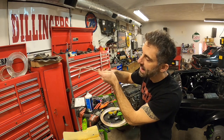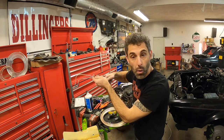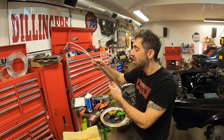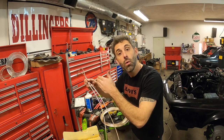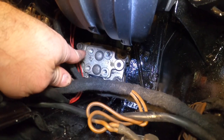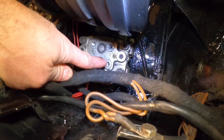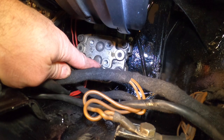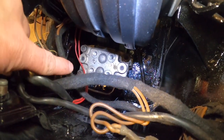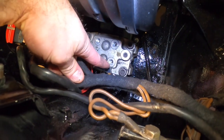As you can see here, I made the 90 degree bends at different heights, and that's to allow for one to go underneath the other in this manner if I absolutely require it. So I want to label one to be the left, one to be the right, and they're both going to go toward the rear of the car. VL and VR are the two for the front, right here, and HL is there. So basically, these two are the ones I need to tap into. The one with the larger 90 degree angle is going to go in the rear, and the one with the smaller 90 degree angle that I made is going to go right on this one instead.